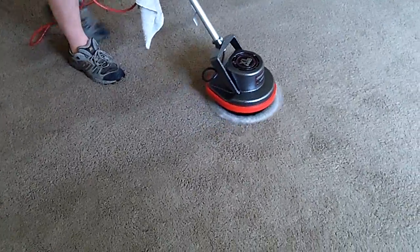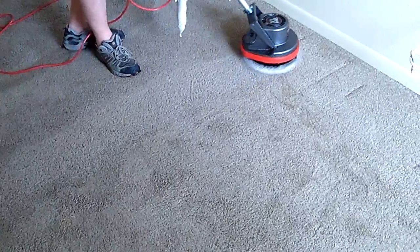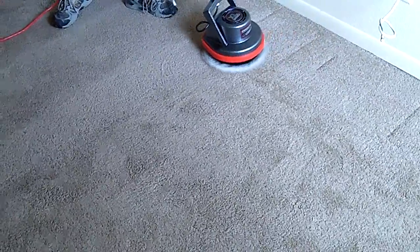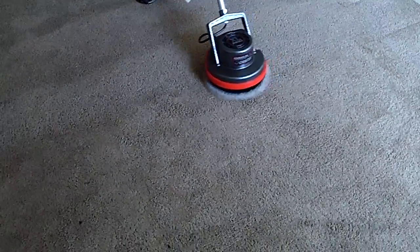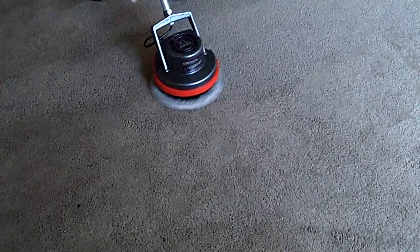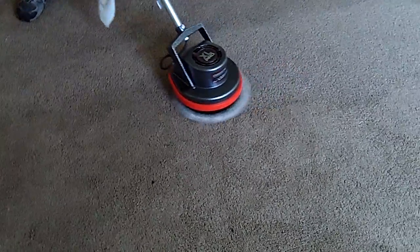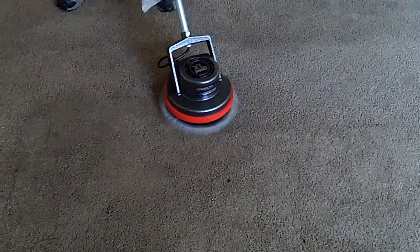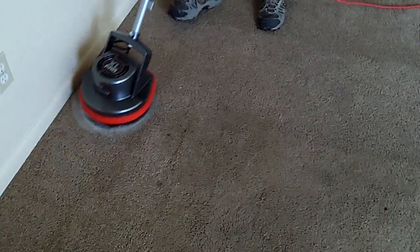Now when you put it back on, you may want to get some toothpicks or something to line the holes up so you can slide it on. The only tough thing is getting the holes lined back up sometimes, but it's not very hard to take apart. Underneath that there's a little plate that you can see from underneath, and you need to take the driver pad off to be able to get to the top. There's a little bolt on there that you take off, and 2 Phillips head screws, and the bolt's so long when it goes all the way through the motor, but it's easy to take off too. Then you pull that out, you can see the relay. And it's just held on by some little snap-on screws, which they're not really screws.